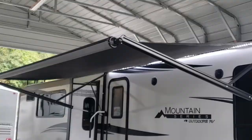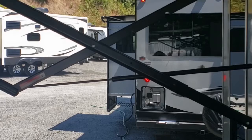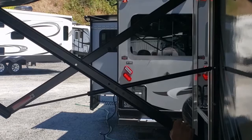It's all about the rain. If it's raining, I would suggest you slope the awning towards the back — the door is towards the front — by pushing in this button and tightening the knob. That lowers it enough up there to have all the rain come off the back end. If you don't slope it, the rain just comes off the very end.